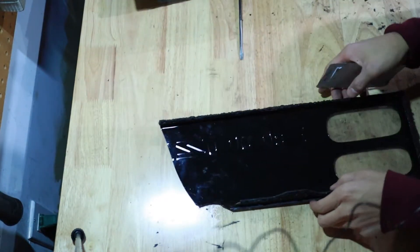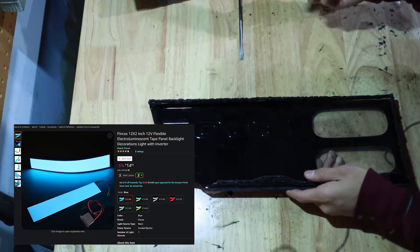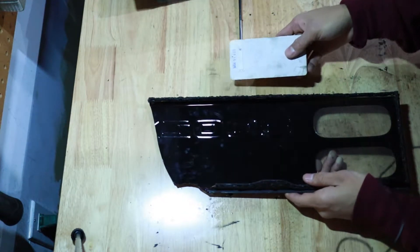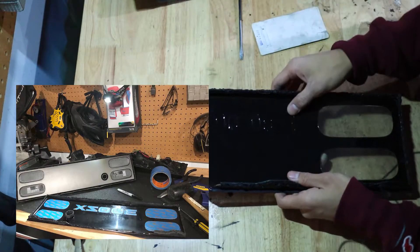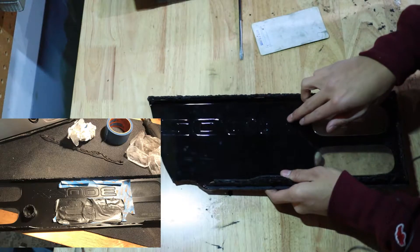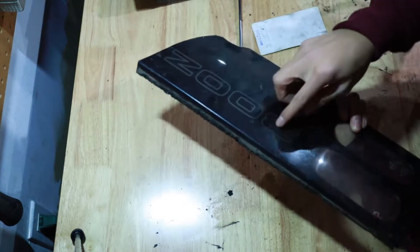Once you get everything apart, you'll get an LED bar — I don't have a spare one right now as it's in the car, but I'll use this as an example. You'll get an LED bar or LED strip. Then you'll paint the whole entire panel black, then sand the '300ZX' lettering — this is all clear to allow light through with the LED.